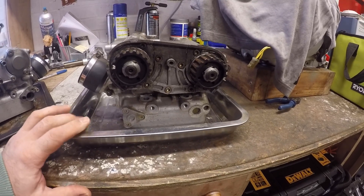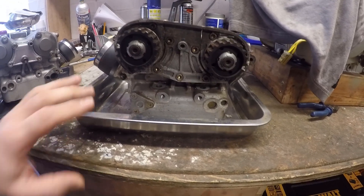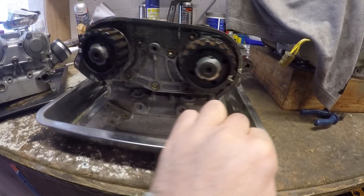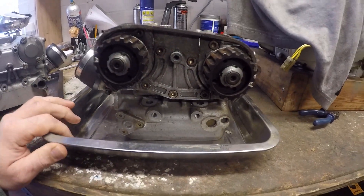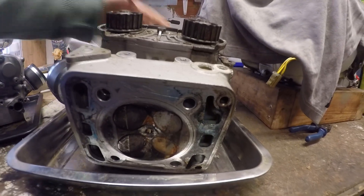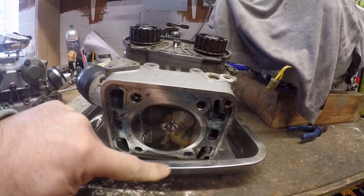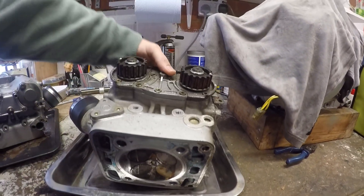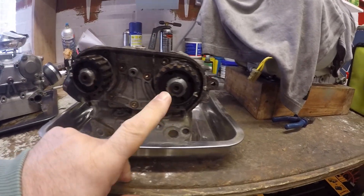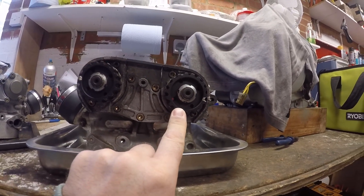Tuning limitations — not really my area of expertise as I just tend to build engines. But my understanding is the ports are the same; it's only the valve train that differs, so you should be able to tune it the same way you would a standard Biposto engine. The combustion chamber is the same as a standard 748, so you can do the same work in there, and the valve size is all the same. The cam has a slightly different part number but it's the same profile, so it's usable as well.